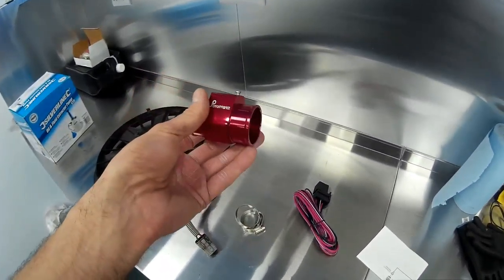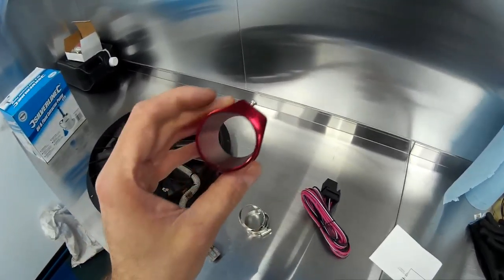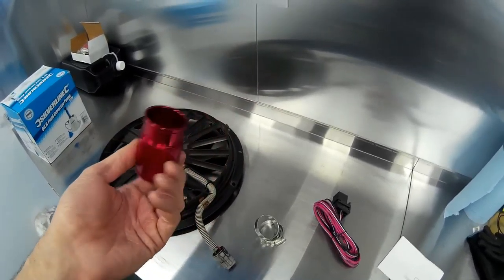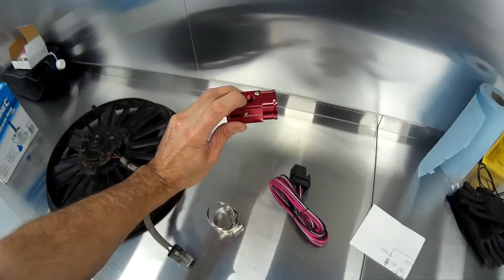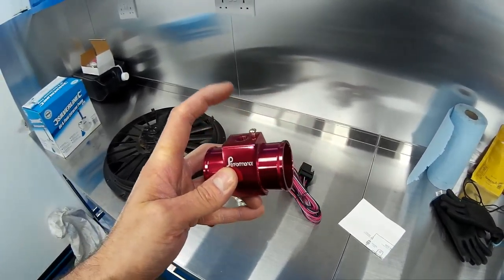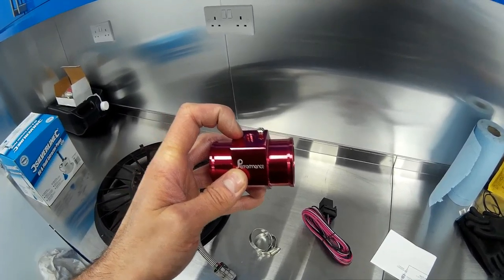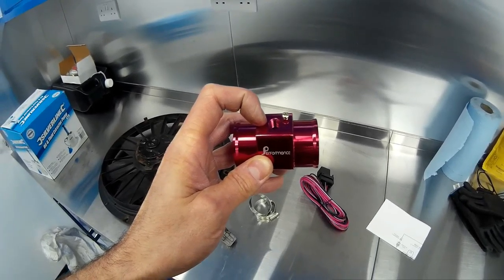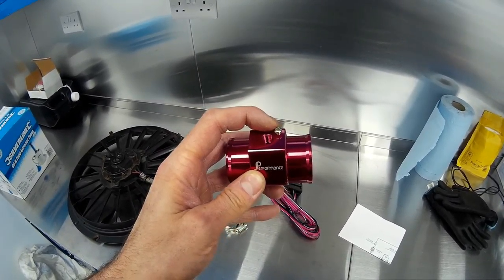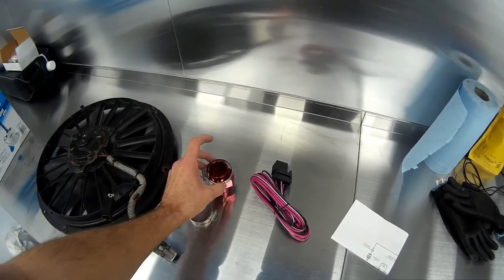This is a 40mm unit — you can buy them in all sorts of different flavours, cost four quid off eBay, turned up in a day with free postage. Made of aluminium, anodized in red — not a particularly nice colour, but you won't see it because it's going to be in the bottom hose. Your temperature sensor unit screws in there, 3/8 NPT, with a little screw there for an earthing point. You're going to need to affix that to a good earth point on your vehicle. If you're using a two-pin plug sensor it'll be self-earthing through the wiring; a one-pin one needs to be earthed through the body to earth as well.